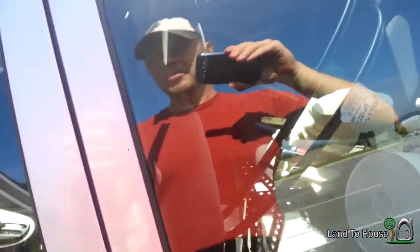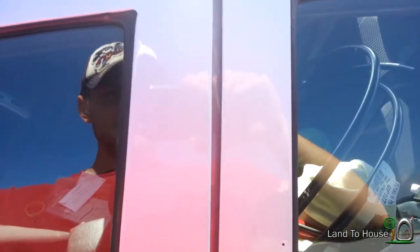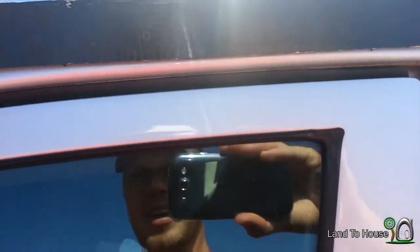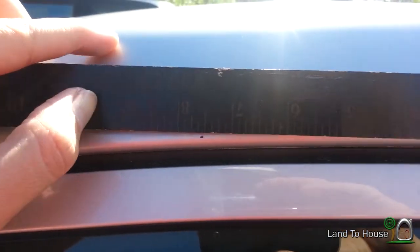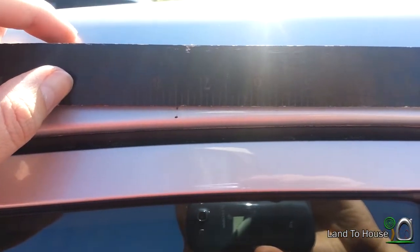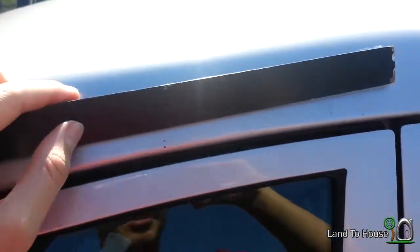Okay, so the paperwork says you're supposed to take the door frame here and measure back this way for measurement A, and that's 250 millimeters. And that comes out to be 9.8 inches. So I'm supposed to put this like here where they meet and come back. So 9.8 is just roughly around here. So I'm going to mark that with these little arrows. So I marked the A position on here, which comes out to right here, if you can see the arrow or not.